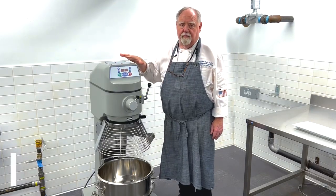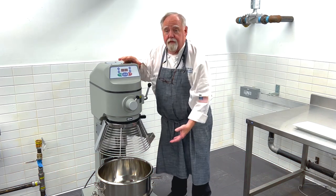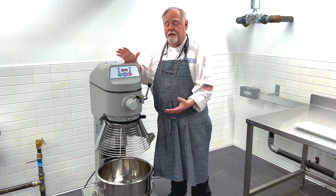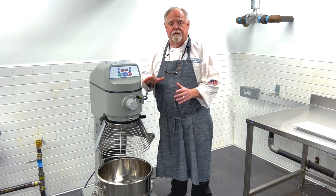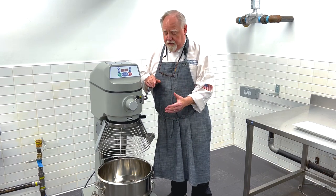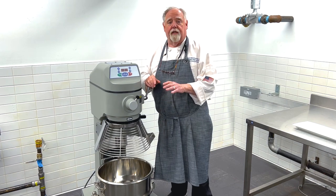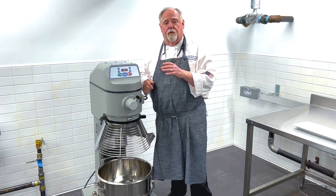Overfilling a standing mixer is a problem for many reasons. First of all, product will flow over. If it's overfull and you turn it on — say you're working at high speed with a very liquidy product and you've filled it three quarters of the way — you will have half because the rest of it will be on the floor. With dough products, filling no higher than the line allows the unit to work correctly.